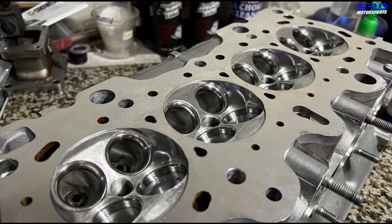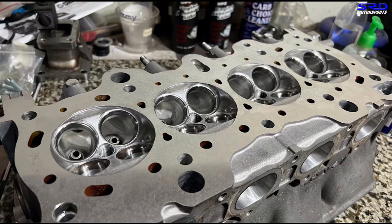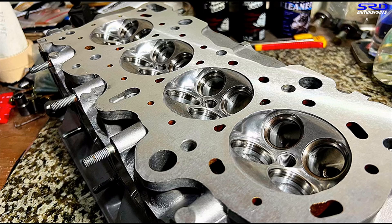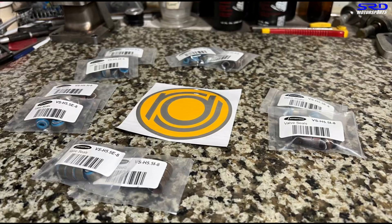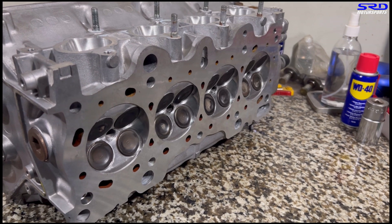Here is the head all done up. We cleaned up the chamber — we didn't really reshape it, we just contoured it and removed all the sharp edges to make it an efficient chamber. This will help making good power since our goal is 180. The exhaust port is finished and looking really good. We also cleaned up the chamber and did the valve job. Shoutout to RDJ — most of the time we get valve seals, either Ferrea or Super Tech from him, sometimes ACL race bearings and Super Tech valve train. Here's the head assembled with the Super Tech valve seals.